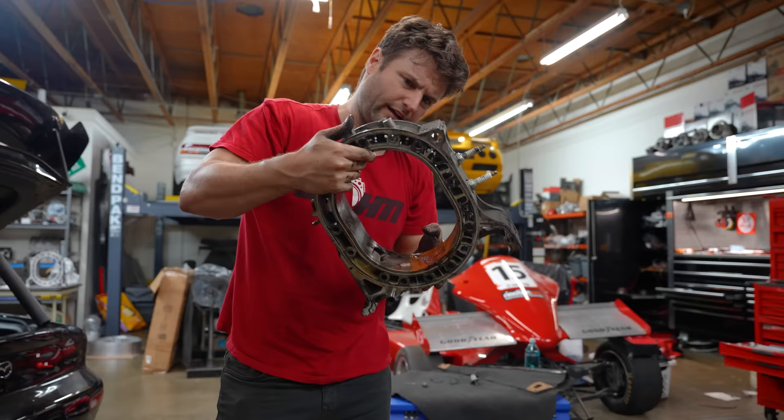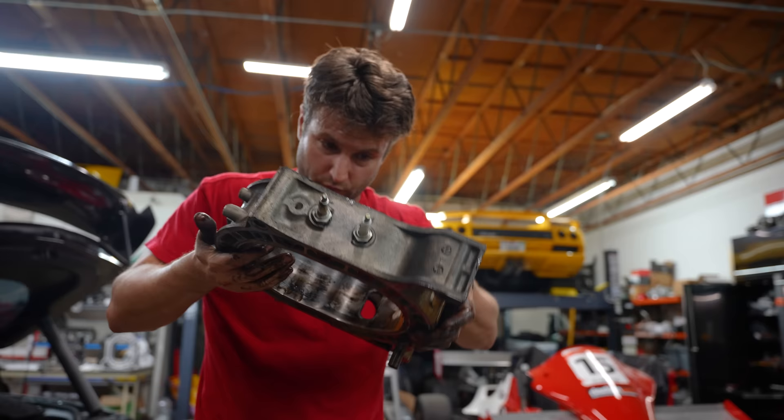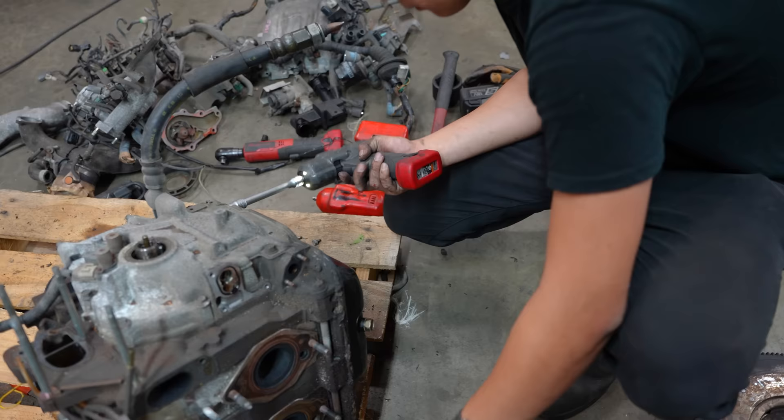I don't know why my seals are so done. I've been using that new Dom racing pre-mix. My seal's stuck. I have a feeling the other engines are going to be better than this one, but the chrome on this is much more consistently worn. There is the telltale sign of the nib on the apex seal — normally that'll wear off like a whole edge. I've ran worse. We just have to make sure they're not both bad. Our goal here is housings, rotors, and rotor parts.